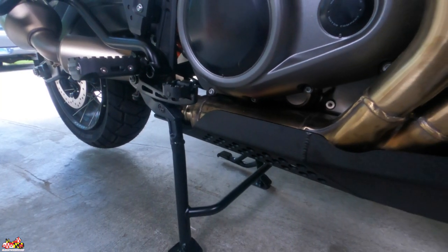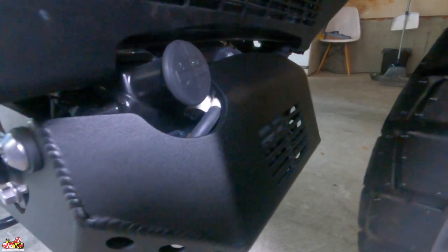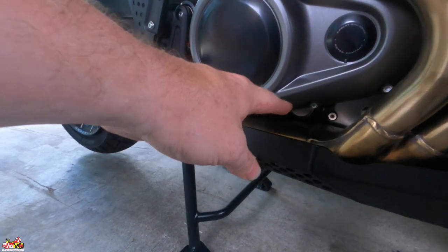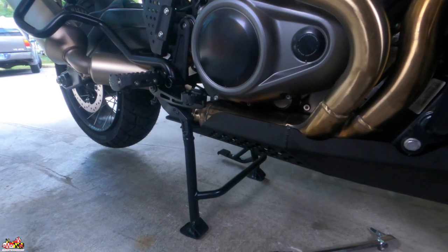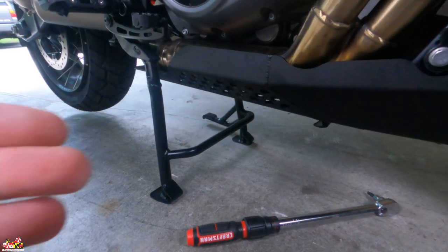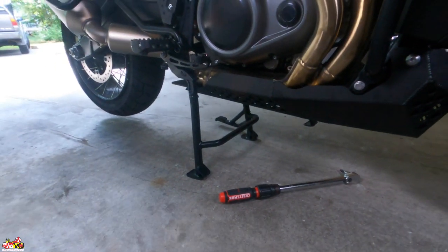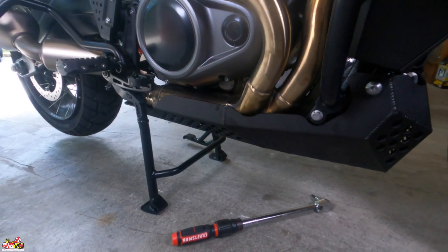I love this because now the voltage regulator, which was open before and sticking out, is covered. I also like that part of your pipe is covered now whereas before it was exposed. Let me show you what it looks like on the bike — definitely a big improvement. There is one small downfall: I liked the look when the entire pipe was exposed. But this is definitely better for extra protection. Torqued it down to 14 to 18 pounds of torque and you're good to go — really, really sturdy.